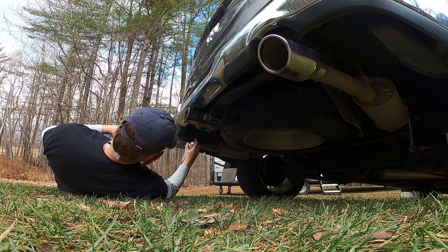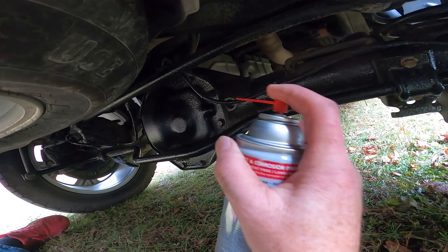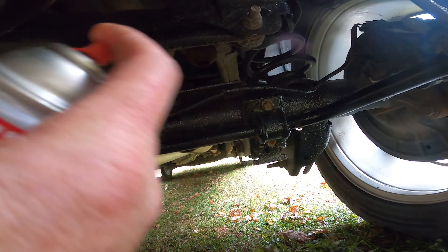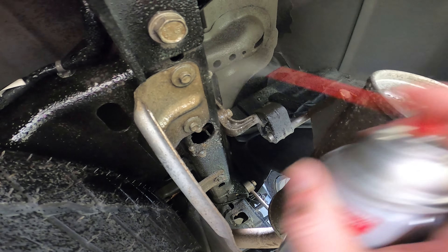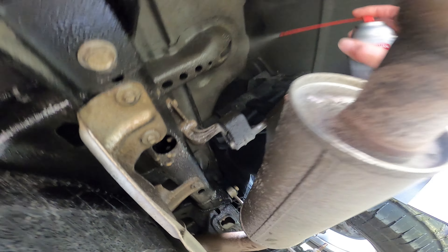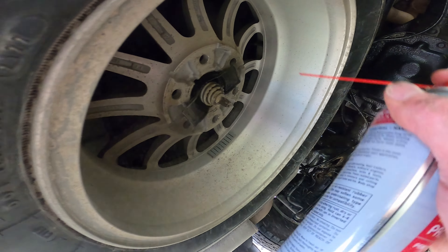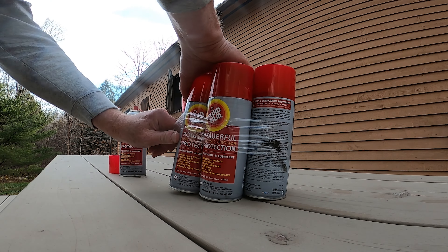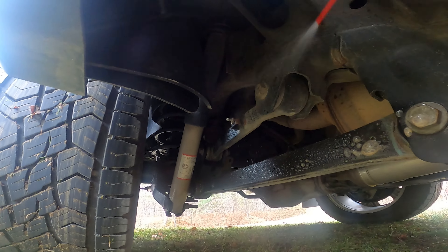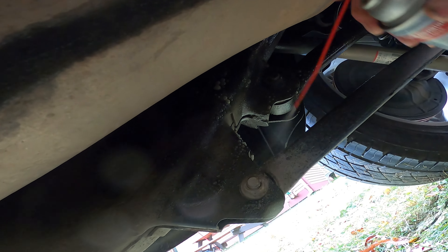I always start in the back with the trailer hitch, then focus my efforts on three things: one, any tiny surface rust; two, black painted steel; and three, bolt threads. If I see any rust at all, it means that area is susceptible to more rusting and it gets a good coating. I tend to avoid large flat body panel steel because that goes through a wash and an e-coating at the factory. But anything that is simply painted black — like the frame rails, brackets welded or bolted to the frame rails, and any nuts and bolts — none of that is e-coated. It's just regular paint and it will rust if you ignore it.